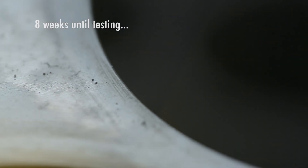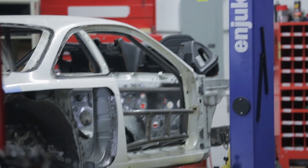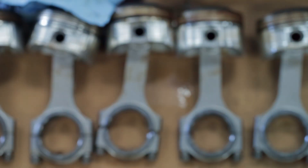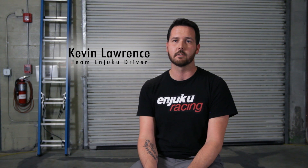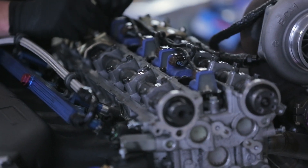RBs are kind of known for having some cracks between coolant passages and the head stud threading on the block inside itself. Luckily the crankshaft, rods, and pistons looked in great condition and are still usable for another block we can build for this season. So we're just going to be short a block, but we can find another one and we'll only be into a rebuild with a set of bearings, some rings, and a little bit of machine work.